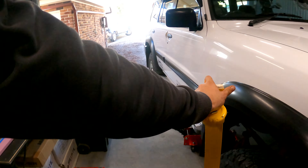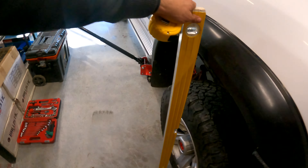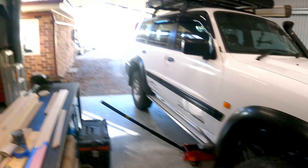I'm just going to use the level and the tape, plumbing down. Get the lines in the middle, go down to your wheel and measure to your hub. That'll at least give me a rough idea when I'm adjusting the panhard rod of pulling that diff back to close to center — just to get me to a tire shop for a proper alignment.